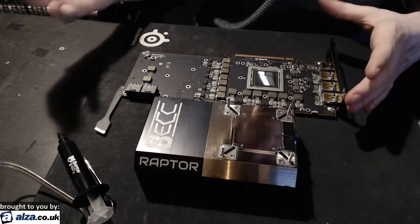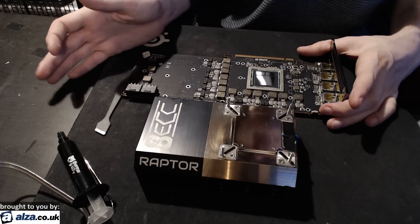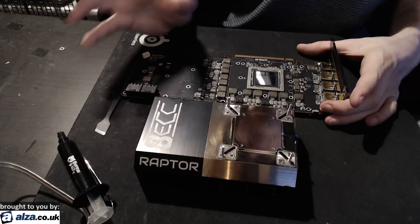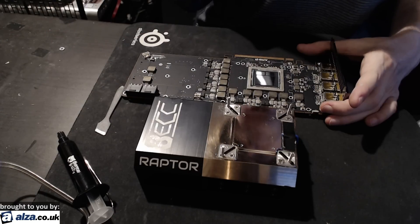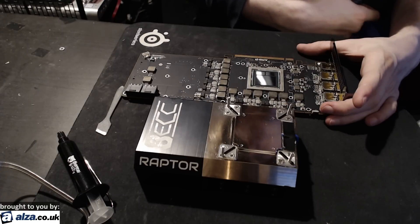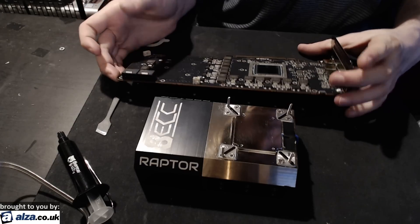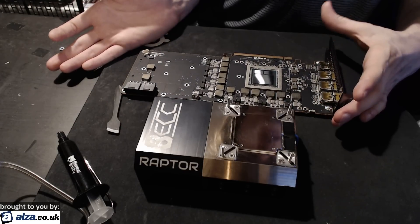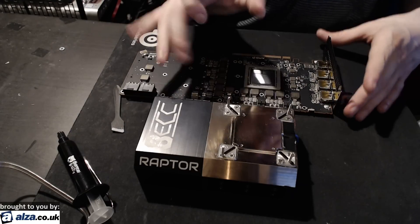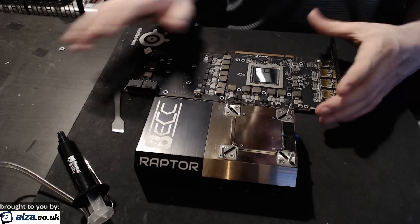I have a method of doing the thermal paste so that it doesn't crack on me, as I've managed to get Vega to run all the way down to minus 130. Below that, the display drive circuit gives up on you, which is kind of unfortunate. I'll try to fix that sometime in the future, but I can't do it on this card. Maybe my Vega 56 will get some extra display drive voltage, as I have gotten the datasheets for the voltage controllers for that.